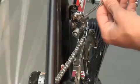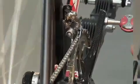You should note that the DoubleTap shifter mechanism does not have a trim click position in the big chainring. Force and Rival front derailleur cages are designed to accommodate the full range of rear cogs in the big ring without chain rub. However, the front shifter does have a trim position to eliminate chain contact when cross-chaining in the small ring.